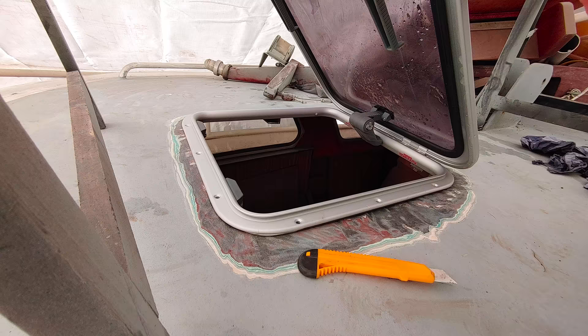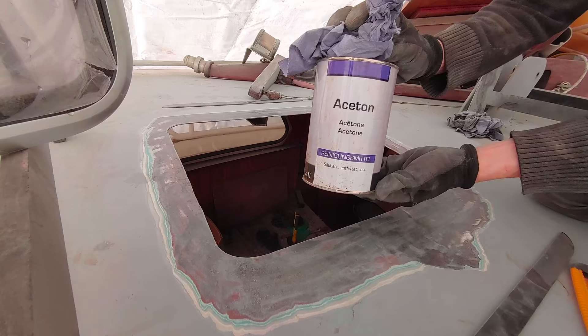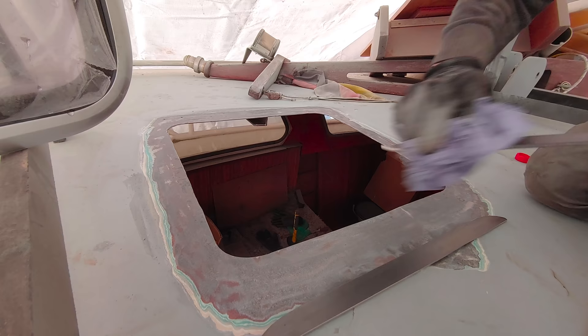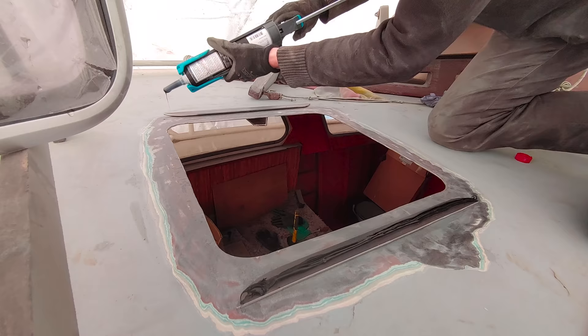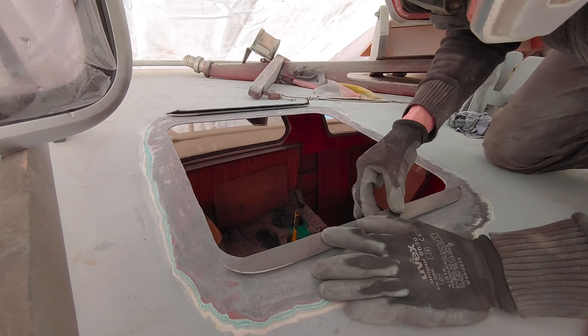Next I mark the optimal position of the pieces so that when I remove them I can put them back in the ideal place. I then wipe everything down with acetone to prepare the surfaces for the next step, which is to fix the metal pieces in place with special adhesive. I use Sikaflex 552, which is resistant to aging and weathering and remains flexible even after curing completely. A positive side effect is that it will fill up the areas between the roof and the new metal pieces to avoid the formation of a cavity where condensation could form and lead to corrosion.